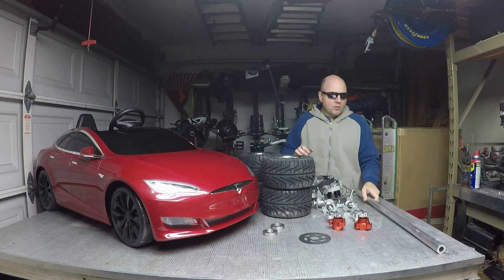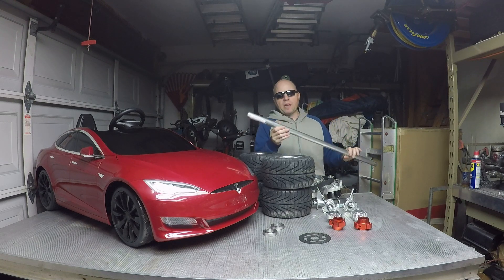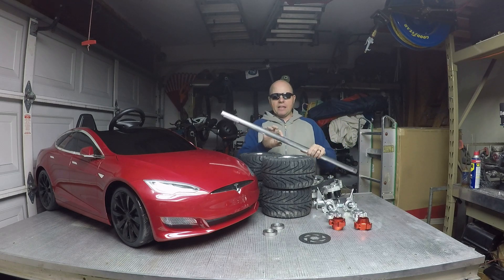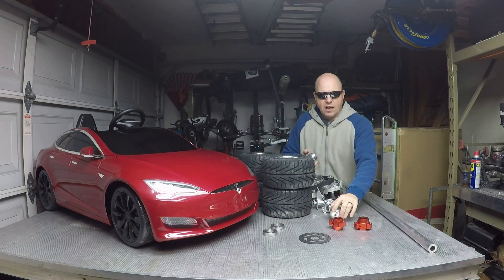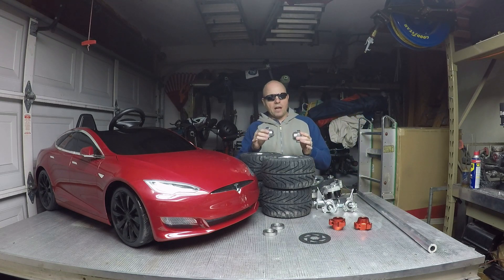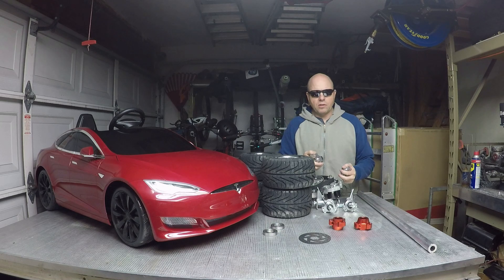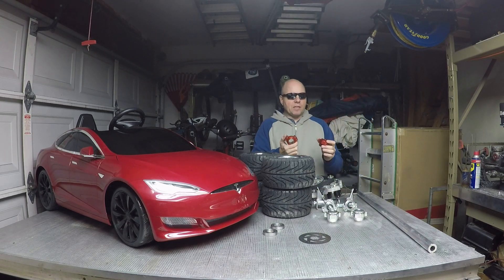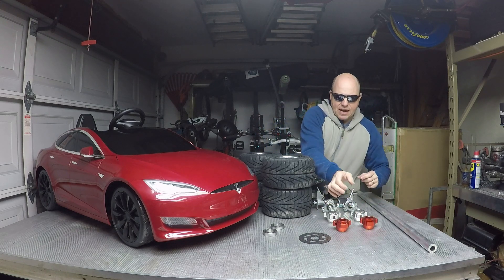This will be an aluminum tube — thick-walled hollow tube — that I'll be using for the rear axle. It will be cut down to length, and then keyway slots will be machined in it to key into the axle hubs. These are the rear wheel hubs I'll be using — standard inch-and-a-quarter bore hubs to couple onto the inch-and-a-quarter axle. These additional hubs I'll be using as a sprocket adapter and brake disc adapter.